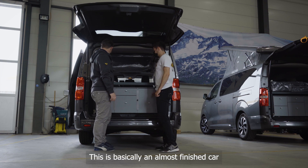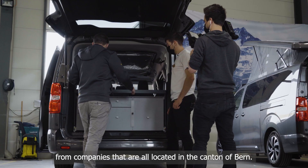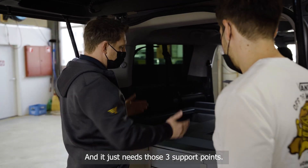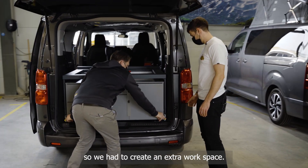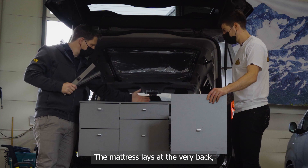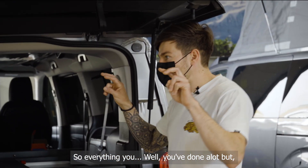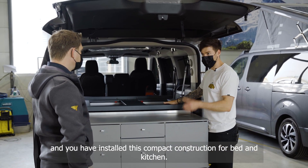This is essentially a nearly finished vehicle — everything regionally manufactured by companies in the canton of Bern. You can see the mattress needs exactly three support points, which ensures ventilation underneath so moisture can escape. And can everything here be removed? Yes — this vehicle is quite short, so we had to create an artificial work surface. The mattress ends at the very last point, and cooking right next to the mattress is a disadvantage unless you enjoy sleeping on grease splatter. So the big work here was cutting the roof and building this compact bed-and-kitchen construction.